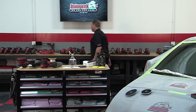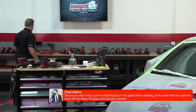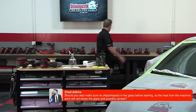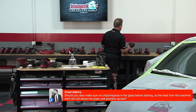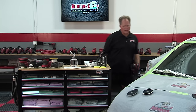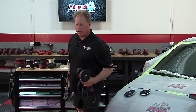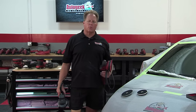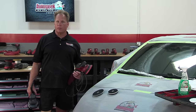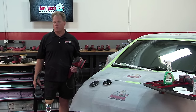All right, while you're doing that, I'm going to bring up another question. We have Chad Atkins here. Should you also make sure no chips impact the glass before starting so heat from the machine will not stress the glass and possibly spread? That's probably a good idea. I can't actually remember ever working on any glass that had a chip in it big enough for me to notice. But yeah, if you're pushing down hard with the tool and there's a rock chip in the glass and it's not filled already with that resin that they use, there's a good chance pushing on it and heating it up is not going to make it smaller.